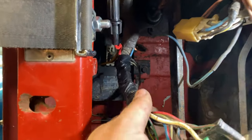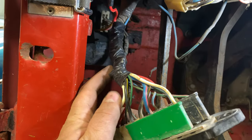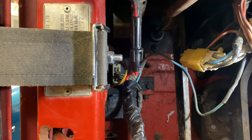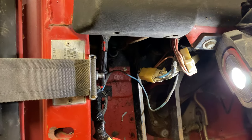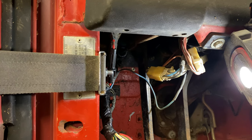I've done a proper job - tapped into the power wire here, soldered it, and now I have my 10-amp fuse here on the non-controlled side, but it is now controlled, running up to the fuel pump. So if something goes wrong we're good, protected right close to the source.